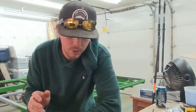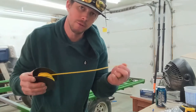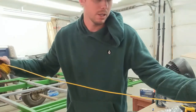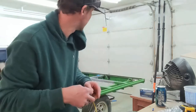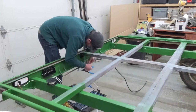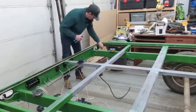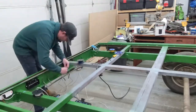Now I'm going to extend all my wires to go to the junction box using color-coded wire for each light — a different color for the tail light, brake light, and running lights. I'll stretch it out from each light to the junction box, cut it, butt splice it in, get all the heat shrink connections at the light shrunk up, and get everything ready to terminate at the junction box.